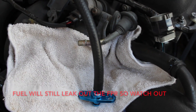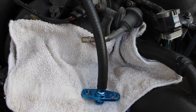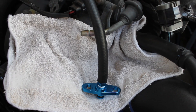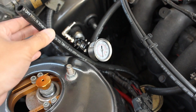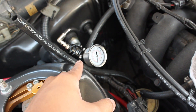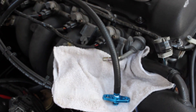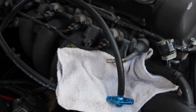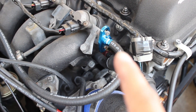I already disconnected the hose that goes to the OEM fuel pressure regulator. I'm going to prep it so I can insert the adapter onto the rail and cut this hose to length to connect to the fuel pressure regulator — and I should be set.